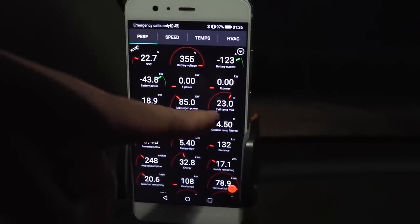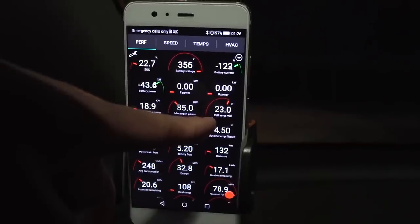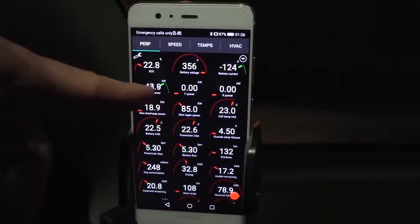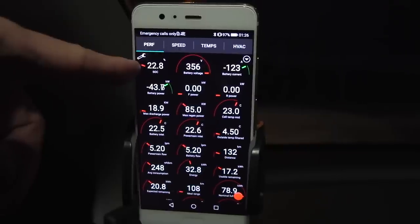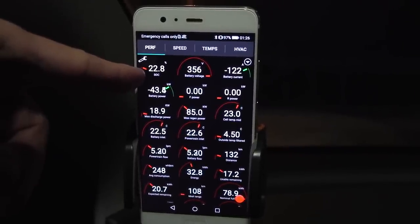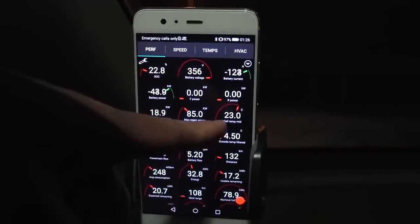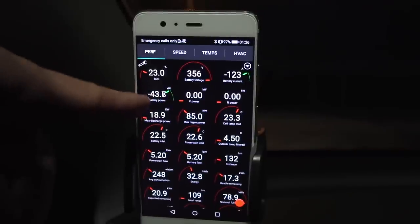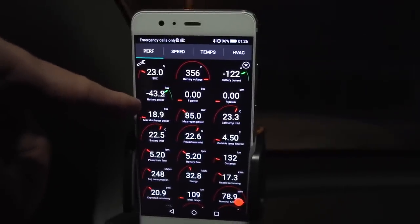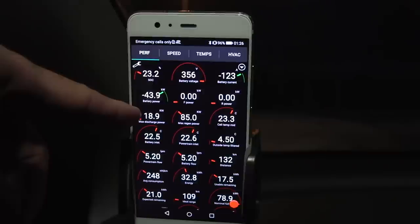By the way, why was it pre-programmed to heat up to 40 degrees back in the days? Well, because eventually if you keep charging long enough and the state of charge goes higher, let's say 70%, 80%, if the battery does not gain more heat, then you cannot receive the speed here. That's why it was pre-programmed to do that. But it was kind of silly because how would you know how far you want to go? But now it works way better.